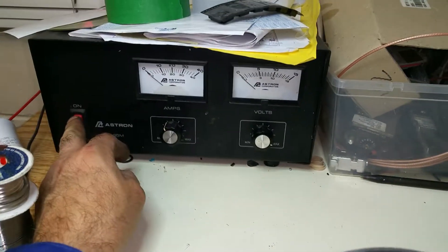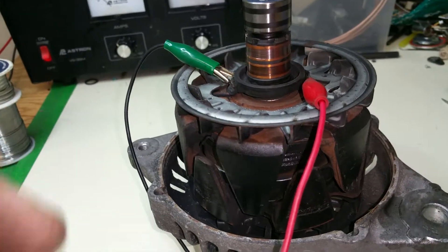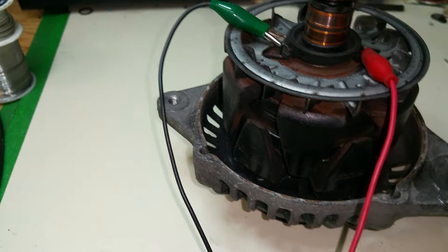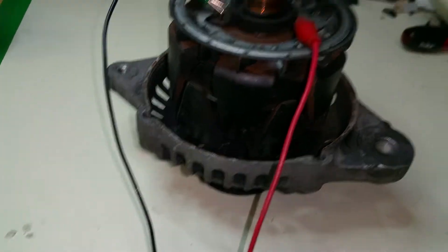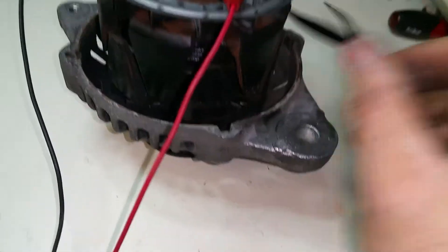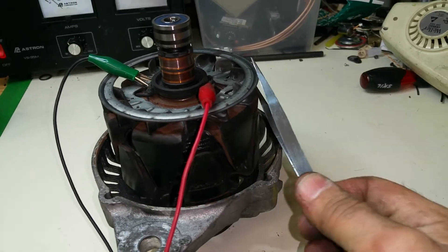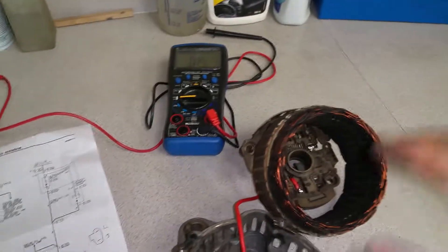What I'm doing here is generating some voltage into this rotor. You can use your car battery, but you have to use a current-limiting device like a light bulb in series with the feeding leads — never connect the battery straight to the rotor because it will fry and overheat it. Right now you see I'm using a metallic tweezer to show there's no magnetic field because there's no voltage. I turn on the voltage and — voila! This gives me a strong magnetic field. That rotating field inside the stator is going to create electric voltage out.